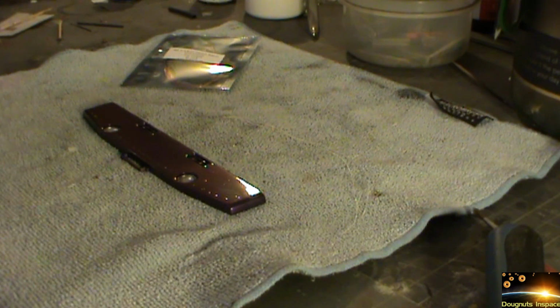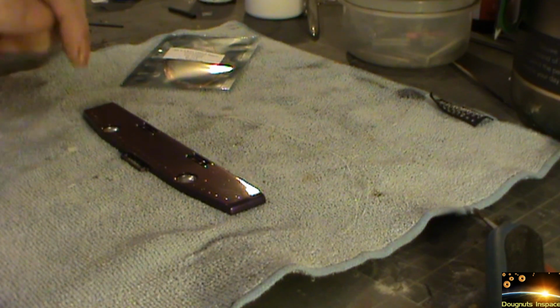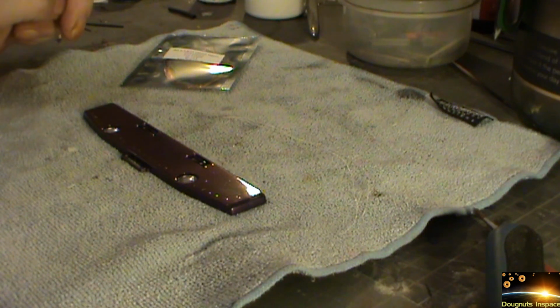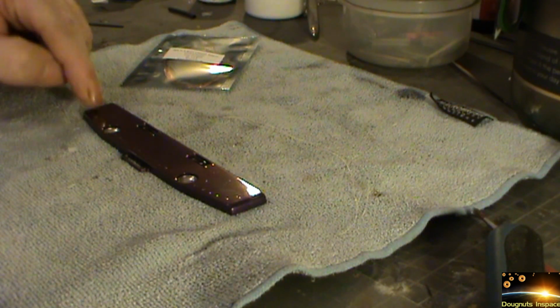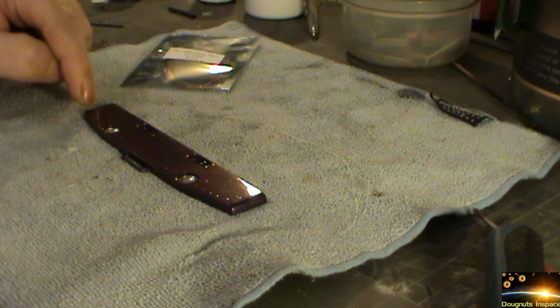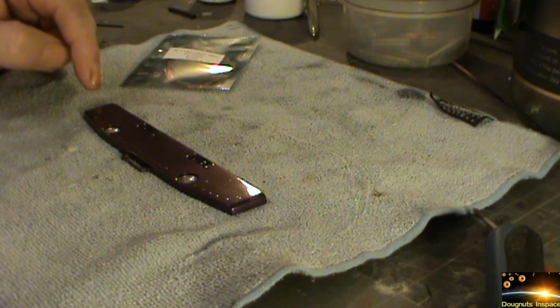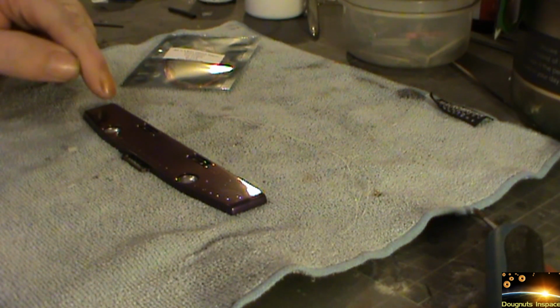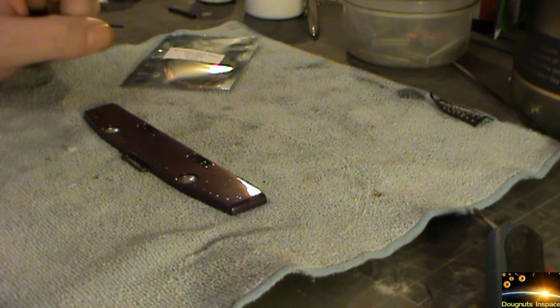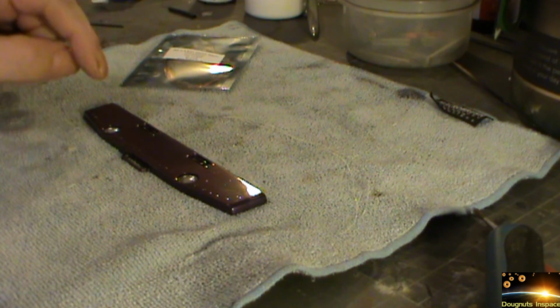But yeah, one of the biggest problems that I've had, which has been holding me back really, is the fact that I need to really get the lights on in the bumper. I really do need to get the bumper put onto the body of the vehicle, or I'm sorry, onto the chassis of the truck, before I really start doing anything else, because I need to get the wires routed through, ready to be put into the sleeper cab.